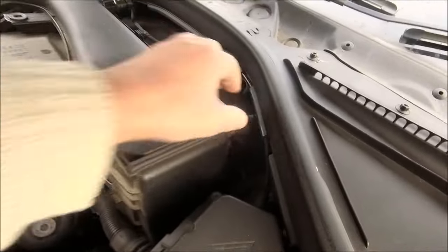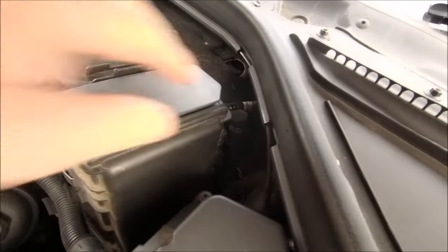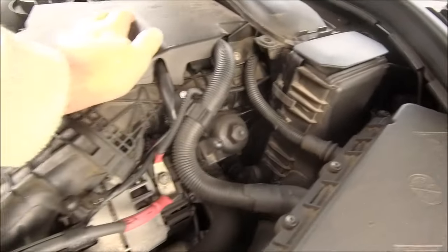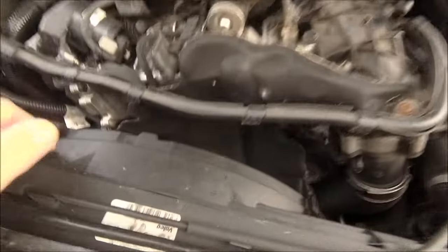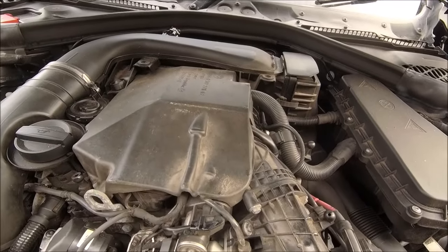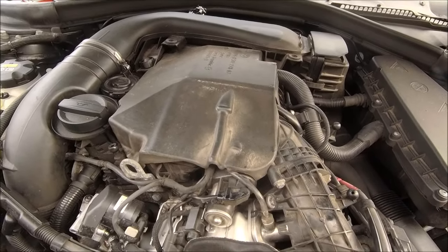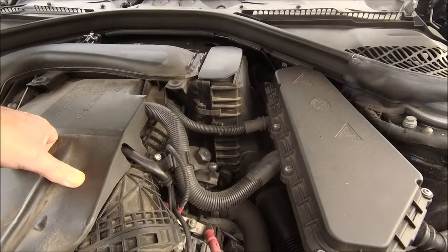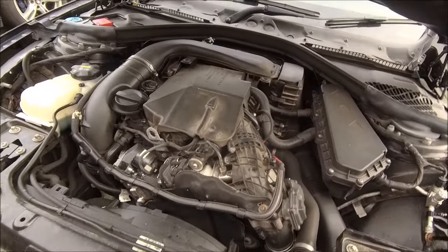Not many people know this on BMWs - they have a dipstick. There you go, there is a dipstick there. So although you're going to put in the right amount, you've also got a dipstick to measure it. Let me get jacked up a bit so I can get underneath. I believe there is an inspection hatch to drop the oil. I can feel rain - spots of rain. There's an inspection hatch so I'm definitely going to have a look underneath, get that open, drop the oil first, new filter in, top the oil up, and hopefully not get wet.